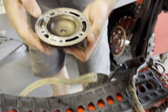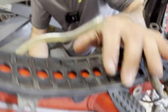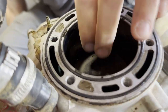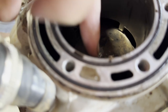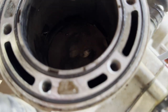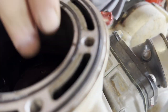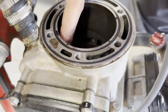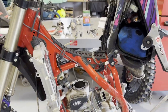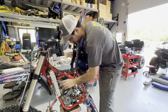Oh yeah, she was hot. I'm wondering how warped this is — we'll have to lay a flat edge on the top here to check. If you look down in there, for as hot as this was, yeah, she's super scored up. Actually the whole cylinder feels pretty good except over here on the exhaust side. We'll play with this more. We're going to cut the video here shortly and come back, because we're going to go riding for a bit this afternoon. We'll get the cylinder off and I'll show you more later.